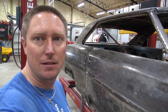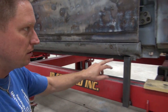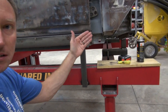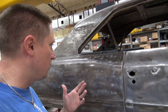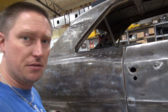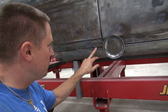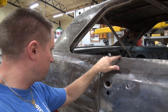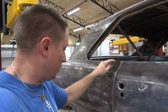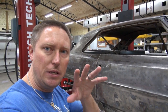I got my door in place — I may still make another tweak. I was really surprised at how long it takes to get a door hung on a car when you're trying to get the seam down here with the rocker really nice and straight, then aligned with the front of the rocker, and then spaced in and out. It's a nightmare — really a battle of inches. It's frustrating too because somebody put rear quarters on this car before, and like everything else done before me, it was a terrible job. Down here you have a great big gap that you shouldn't have, so you can't really count on the vertical position to line up your door. Getting it placed properly turned out to be like two or three hours of work, constantly tweaking and moving the door little by little.